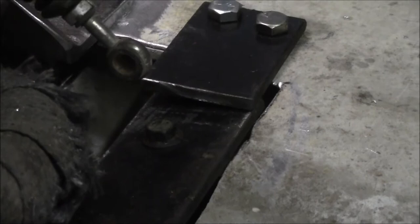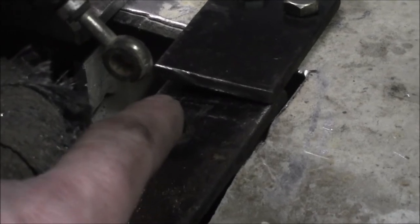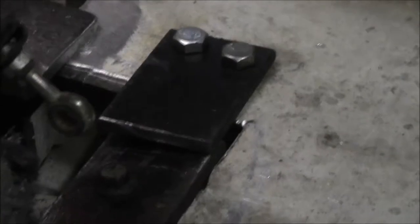So I'm going to try welding this corner first. And then I'm going to maybe throw a few thick beads underneath and then build up my weld and try to maintain that twisted angle that's on there. And I'll do the same on this side. I'll just tack it, keep on tacking it with my little MIG welder.